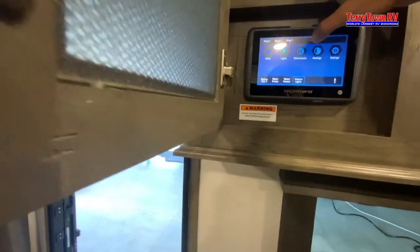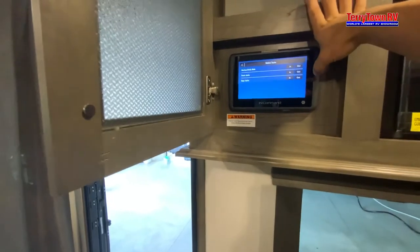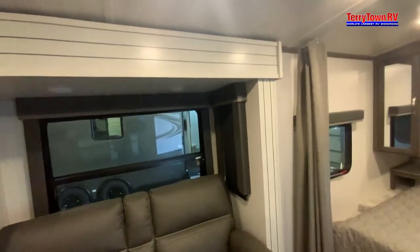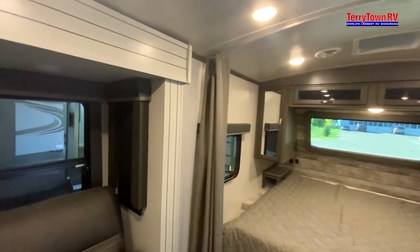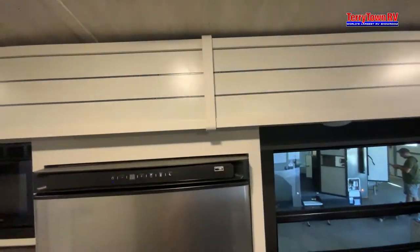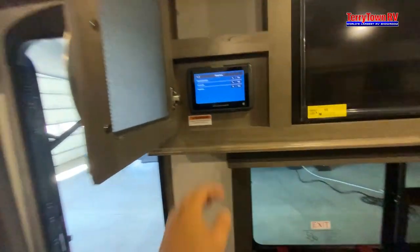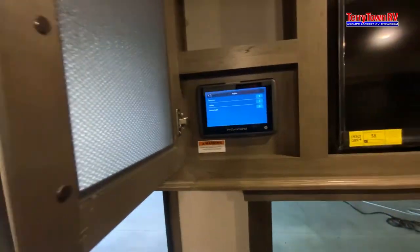Looking at our slides and our jacks. Our front jacks will do both of the front and both of the rears in and out. The slide — the power dies off once you're fully in or fully out, and you do want to bring the slide fully in and fully out. There's also a motor right in the middle behind this fascia that has a spot for a socket to manually override the slide in case it electrically goes out. Lights — it's just light switches all over.